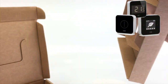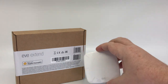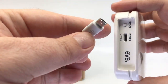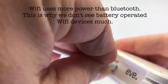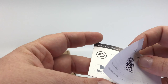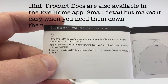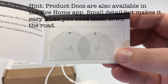I'm a big fan of the new EVE products — the black and steel chrome style — but in this case it really doesn't bother me much because this is not really a product I'm going to be displaying. Although most of us are used to EVE products that are battery-operated, that is not going to be true here because you've got a Wi-Fi adapter in it. Because this is using Wi-Fi and not Bluetooth, it is going to consume more power on average because it's always connected. Although we do have all the documentation and it is very thorough, it's not actually like we need it, because this is a really straightforward setup. You plug it in, you add it to HomeKit, and the app takes you through everything you need to know.